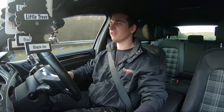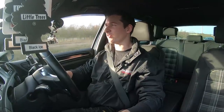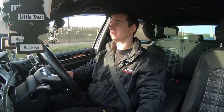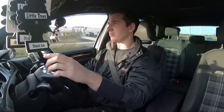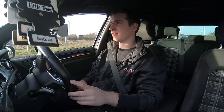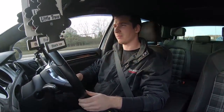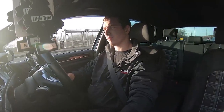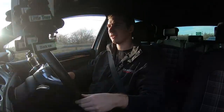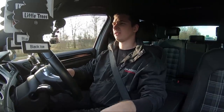That's one of the things that kills drivetrains as well. If you've got 500 foot-pounds of torque at 1500 RPM, it sounds amazing and it'll probably drive amazing — but how long is it going to last? All that pressure and force is getting put into components that are spinning slowly and trying to accelerate them. That's why people buy diesel engines, to get more torque at lower RPM. And even away from the lowest RPM, you still get a decent shove compared to a petrol engine. Variable vane turbos — petrol-wise it's still probably only the odd petrol car that's got one.